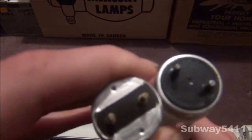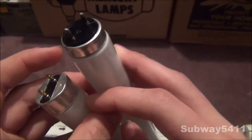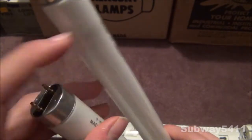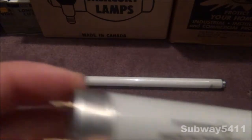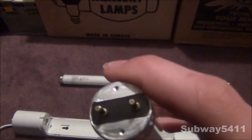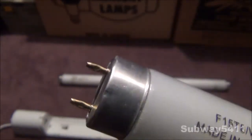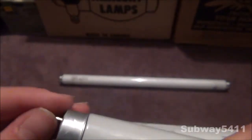So let's take a look at this end cap right here. We can see a big difference between this one and that one. This one is a bit smaller and this one is a bit bigger around the edges. Also, this one is very flush with the arc tube itself — this one is smaller than the arc tube, but this one is bigger than the arc tube. Now, this black part is actually made out of cardboard on the newer bulb, whereas the black part on the older one is made out of plastic. That's a big sign they're trying to save money. We can also see that this one is a lot bigger and it has brass pins, meaning it is corrosion resistant, whereas this one isn't — it could actually corrode around the little pins on the side.